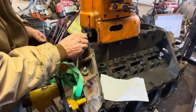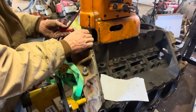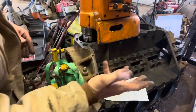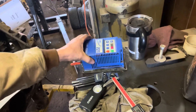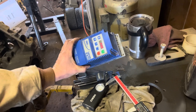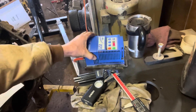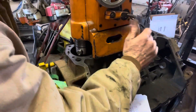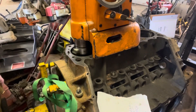You've got a flat side on this cutter — stick it in there and there's a set screw over here. Tighten that down. I get my cutter down close. This is an automatic feed. I've got to turn on my phase converter, and what it does is it comes up to speed. That's the hertz coming up — it should come up to about 28.7. I'm going to kick this in gear. We've got two different speeds on this machine — I like to go with the faster one. And it starts cutting — you'll hear it starts slicing on it.